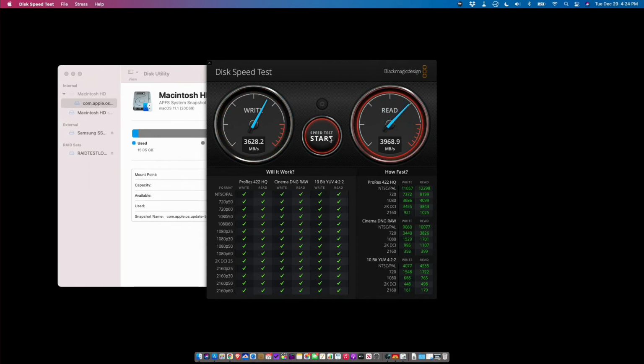See that? And that's closer, you know, that's not quite 40 gigabits per second, but that's closer, right? So if we're looking at 4 gigabytes in gigabits, we're getting 32. So this is what I was expecting we would get. This is like 32 gigabits. So we're definitely getting more than 20 off the two drives. And I was expecting that. But again, we've got two distinct connections here, so maybe that's why.